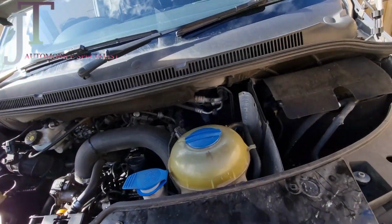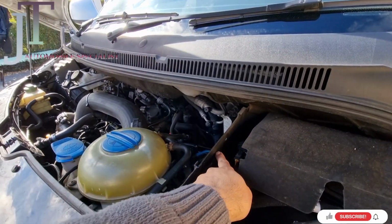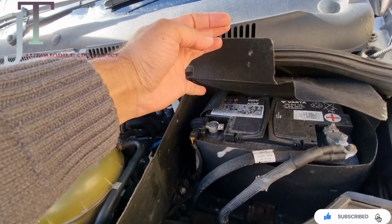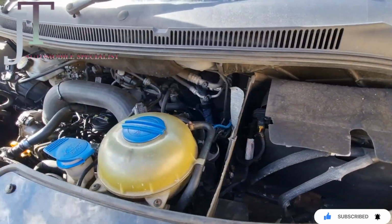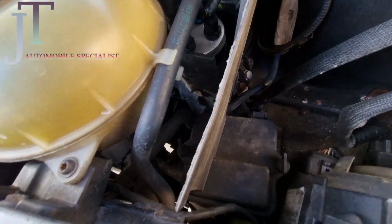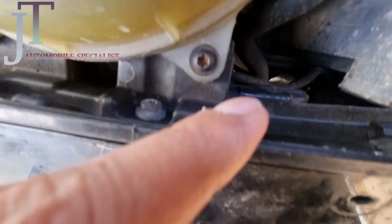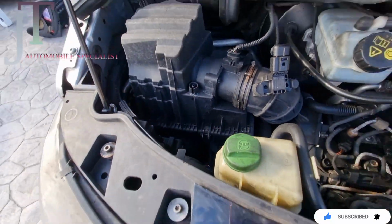What I'm going to do is make a hole here to put the relay in, and then that's your battery. One is for positive, one is for negative. And the short cable, I'm going to drop it down from here to the fog lights, and I'm going to tie it up from here under this all the way, and it will go right on the bottom for the right side.